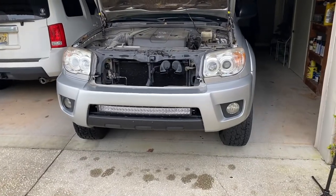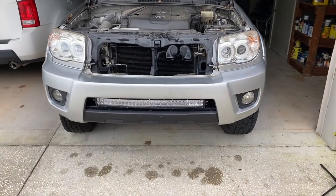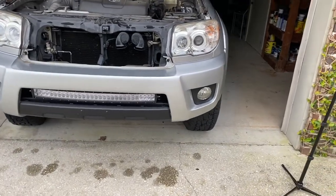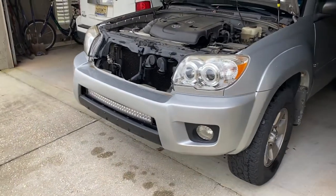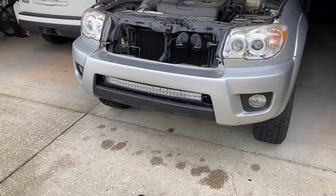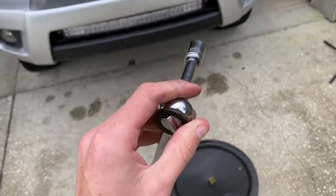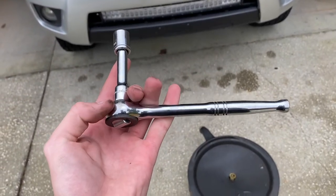Now that we have the type of oil and the oil filter figured out, it's time to go up under the car and locate the oil drain plug. I don't have the luxury of a fancy jack lift like in professional shops, so I've parked my car on a little bit of an incline. I also have a level kit in the front that brings it up a bit, which is going to allow me to crawl under there and loosen the oil drain plug from the ground. I grabbed my 14 millimeter socket wrench and put a little extender on it because there is a metal plate in front of where the drain plug is, so you're probably going to need this extender to reach in there and break it loose.